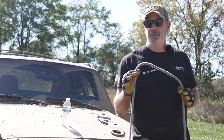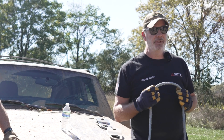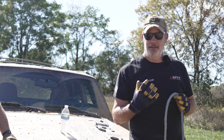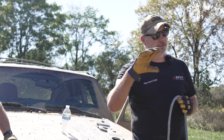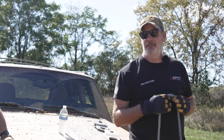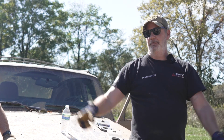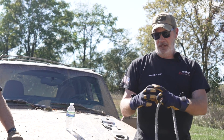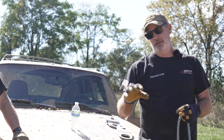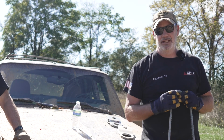So what happens when this breaks? It's got less energy in it. So that steel line, it's got more mass in it, right? It's not only more mass, but it's also wound steel cable. So when that steel cable breaks, what's it want to do? Unwind. It's got a very big signature, so a big profile. When it breaks, it's not just here, it's very big, because that wound steel cable unwinds, and it has a very big area of destruction potentially.